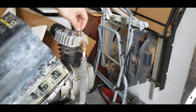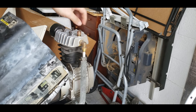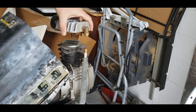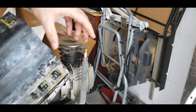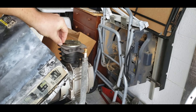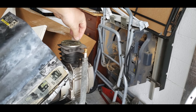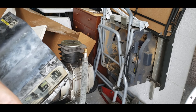So I pulled the head off — it's just four bolts, a number five Allen key and a three-quarter inch bolt for the air inlet. Pulled the head off and the gasket and discovered that my reed valve was broken. Ordered one on eBay, just under eight dollars. It came in today, so I'm going to install that and see if it fixes my problem.